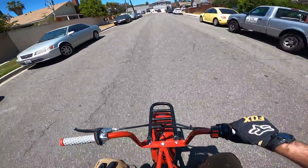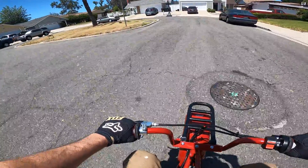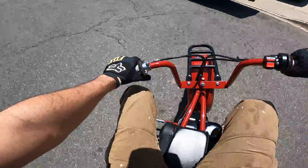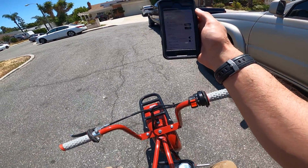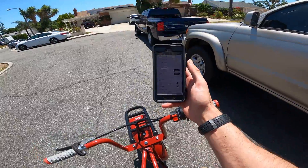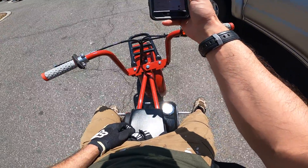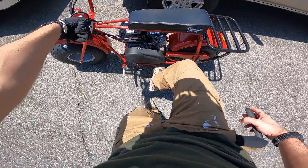It's hard to tell what that really was. This thing's got a ton of torque, but the top speed is really limited by that rear sprocket being a 52. Let's see what that sucker says. The top speed was 40 miles an hour — 39 miles an hour, so I'll call that 40. Not too bad. So trip history — yeah, 40 miles an hour and I could have gone further. Not too shabby. I think the original top speed was 18 on this thing.